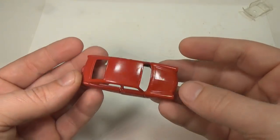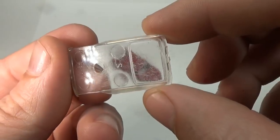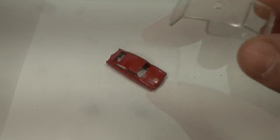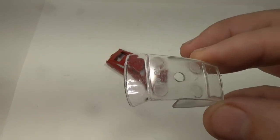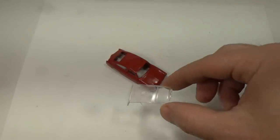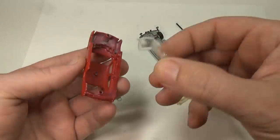All that's left to do is clean up the windshield. To do this I'll first wash it with soap and water and then polish it with polishing compound and a polishing wheel. These old plastic windshields are thinner than modern ones and tend to have a lot more defects from their manufacturer, so don't be surprised if you can't get every imperfection out.